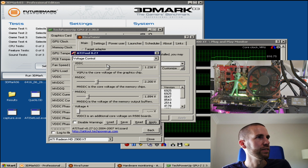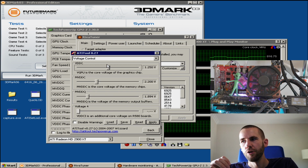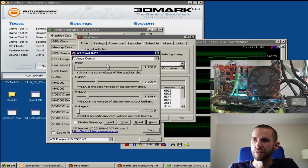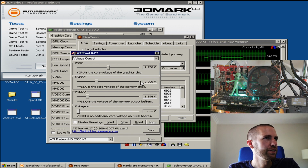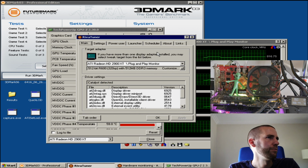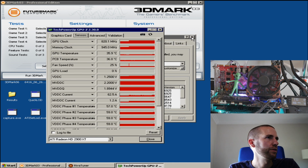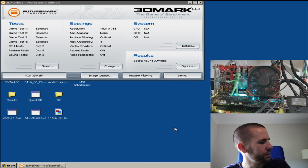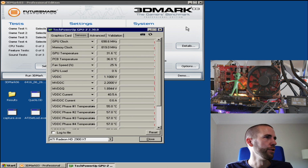I should now be able to go and apply volts. And thankfully this card is new enough to have two different power states for 2D and 3D, because otherwise once you set a clock that's past a certain threshold, it just wouldn't set the clock without the voltage set. So then you have some sort of a weird chicken and egg problem. Now I'm curious if I now close everything. Okay, let's do the litmus test now. Let's relaunch GPU-Z and see if the clocks are still there. No.